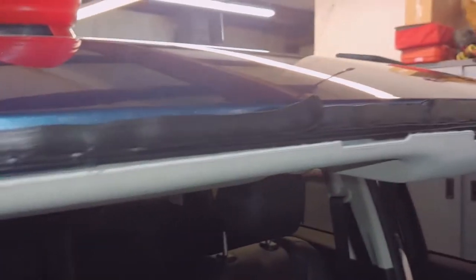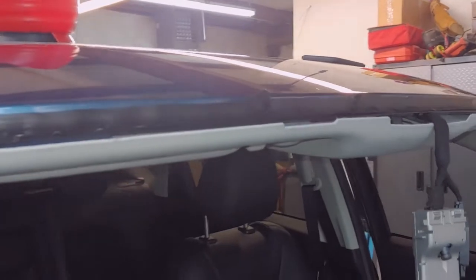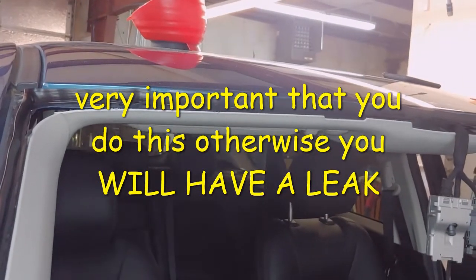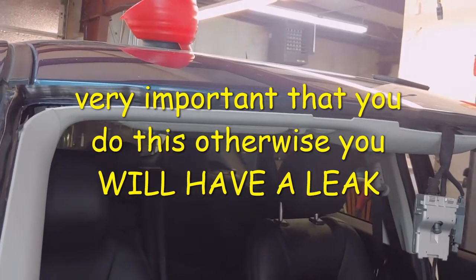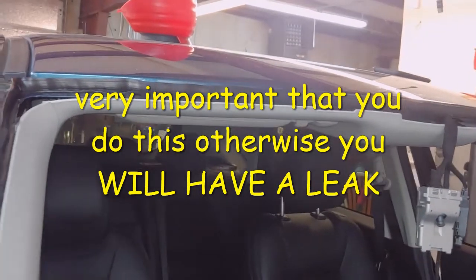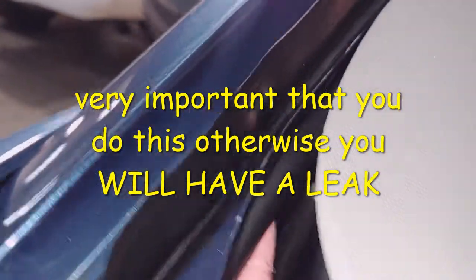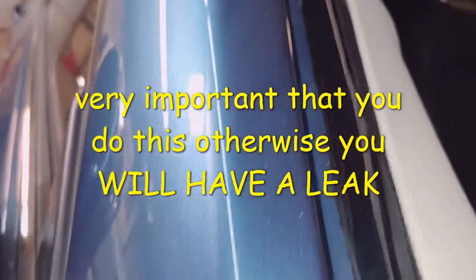Laying down the urethane, as you can see, the bead, you want to make sure it's all nice and even. Right there where they meet, you just get a little tool or a little popsicle stick and blend them in together. But as you can tell, it doesn't take that much. It's probably 1/2 inch, 3/4 inch high.